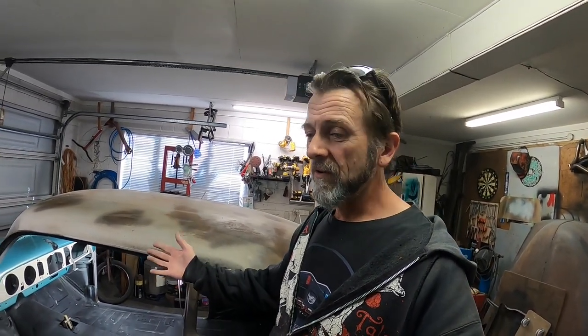it'll hopefully flatten down. I thought I had my line pressure sorted on my spray gun, and it was fine on the colour, but I set it pulling the trigger, and I thought it was about 25, but I checked it again later and it was about 20 when the trigger was pulled. So I ramped it up. I was halfway through the clear before I figured that out, and I ramped it up for the last couple of coats of clear, and it made a huge difference to how well it sprayed, because I was struggling on the bigger areas.